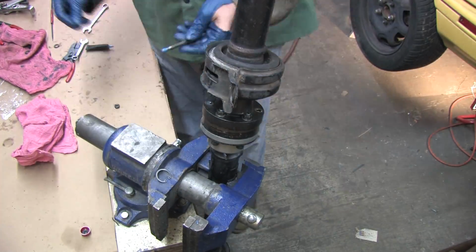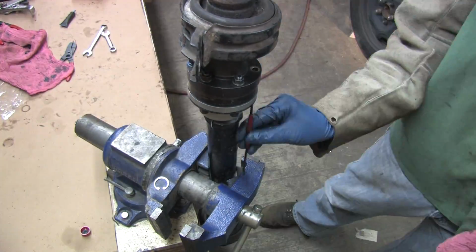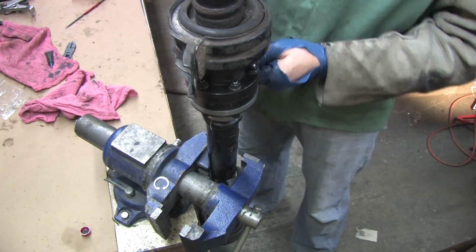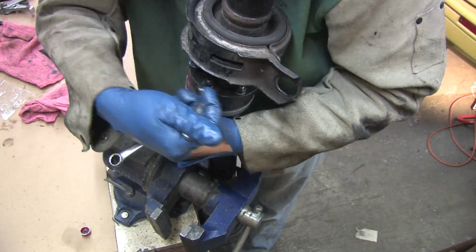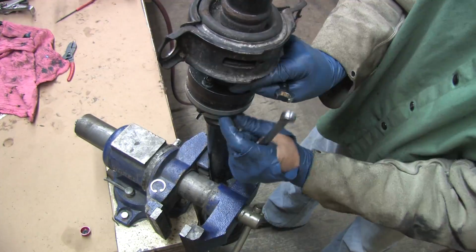Since my red Loctite was dried up, I'm using the blue stuff for principle. It's not the right stuff for doing this job. I'll fix it later. Sadly, I left that out of the other videos. Always use red Loctite on Lobro bolts. They don't require much torque, and you don't want them vibrating loose under any circumstances.